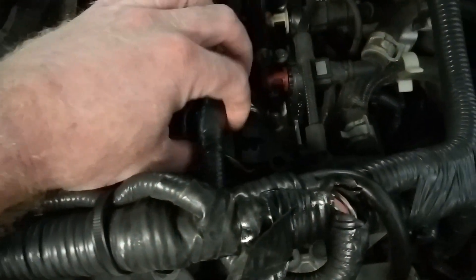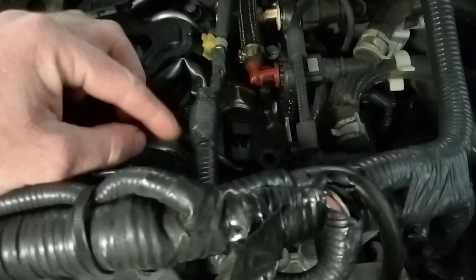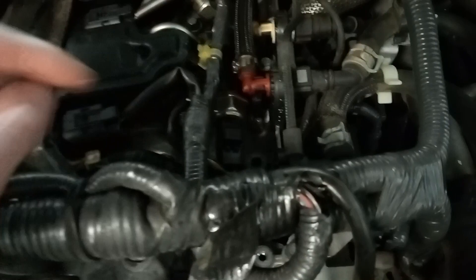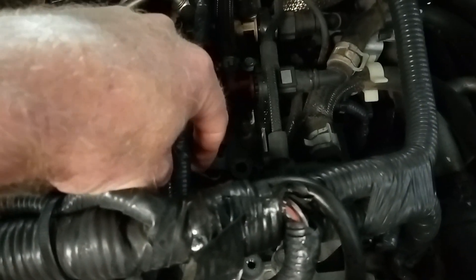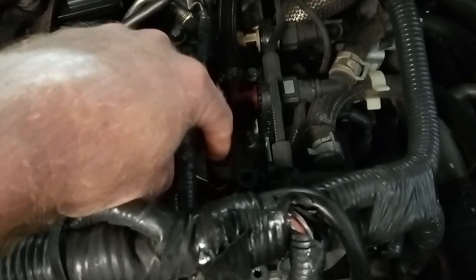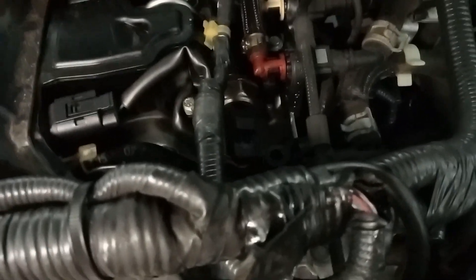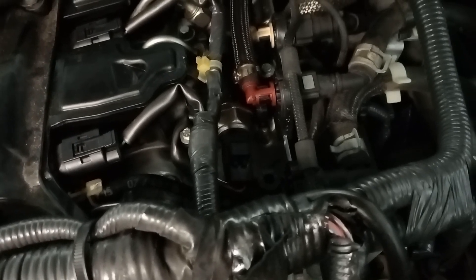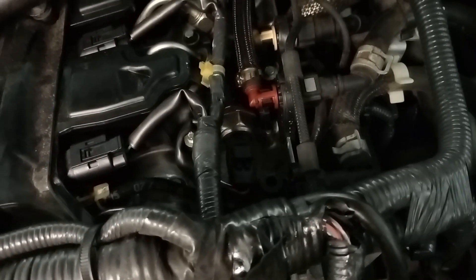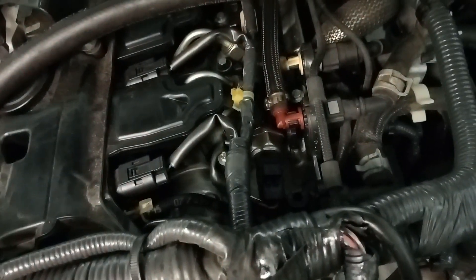So what we're going to do is send it up to the auto electrician to pin out these wires from the plug and replace those wires probably all the way back up here, just to make sure we're covering that whole section. I think our break is down fairly near to the plug. If you have that fault code for the fuel pressure sensor circuit, make sure you check the wiring first, because that sensor from Nissan retails at $1,300.